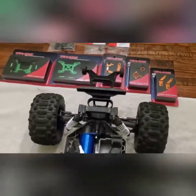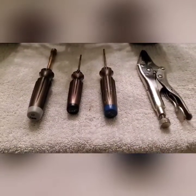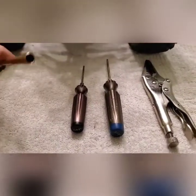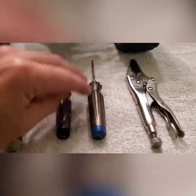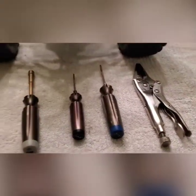If you're going to buy parts, go ahead and just spend the money and buy the quality parts. This entire truck can be taken apart and assembled with four tools: a seven millimeter wrench, a five sixty-fourth allen, a three thirty-second allen, and any wrench or plier of your choosing.